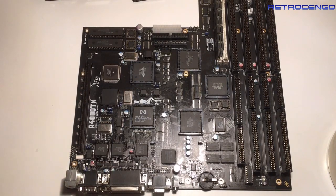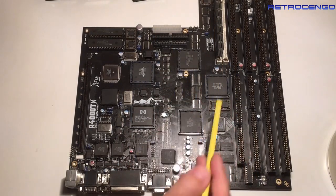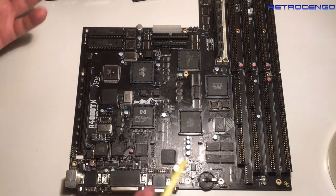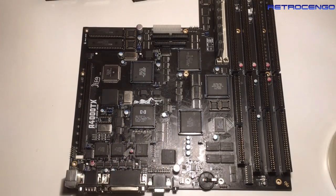I mean, if you just take a look at the RAM, I love the revision D because it has got 2MB chip RAM on board. Now, I think that's the easiest way to see it: if you just take a look at an Amiga 4000 with an open case, you can see the older revision has got 5 RAM slots and the revision D has got 4. And the clips are made of plastic, they crack off, and it's not easy to find a 2MB card to put in your chip RAM. And on the revision D, it's just on board. I love it. That's the first thing.